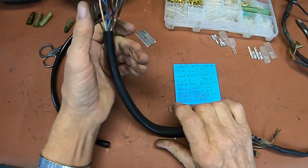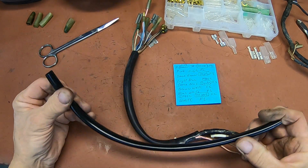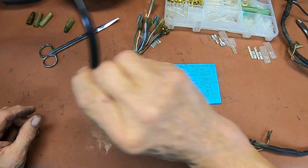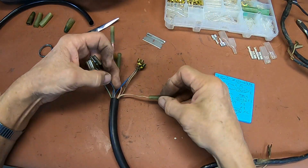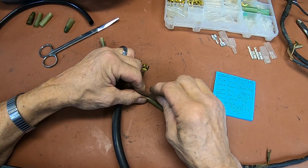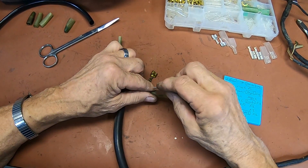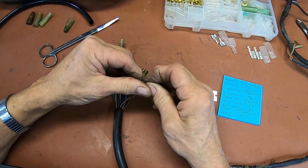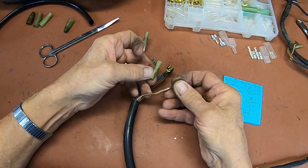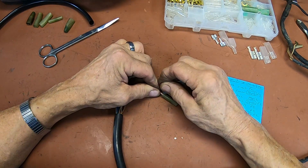See, this is our problem right here — this is just so stiff. It's hard to manipulate and it's going to break. So I've got a new portion of vinyl cut here — it's a little bit longer, I can always trim it. You don't want to cut off too much of this. So just take your razor blade and get in there and cut it. Sometimes these pull off, but not very often. These are really good ones — early connector covers. You want to keep from cutting off any more of the wire than you have to.